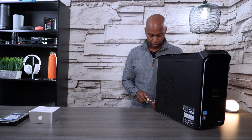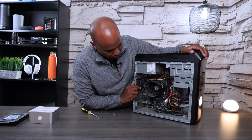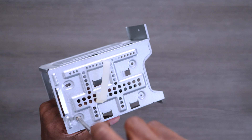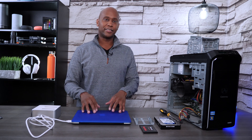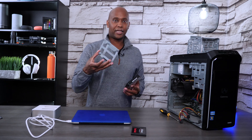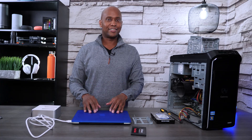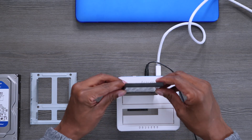I'm going to go ahead and get the hard drive out so we can start the cloning process. See how easy that was to get that hard drive uninstalled? Now when you go to a solid state drive, you're going to have to get an adapter so it can fit the same size screw holes as the full-size drive — just take that in mind. Let's open up the computer and see the files on both drives so we can see what's going to duplicate once it's done. Make sure this is powered off first, then line this up and make sure they go into those SATA slots inside.